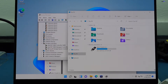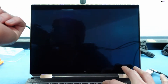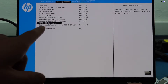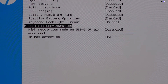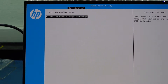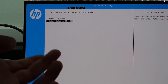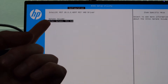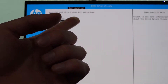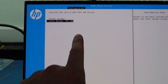So we're just going to go into the BIOS. Let's hit F10 — turn it on and just keep spamming it to make sure you get it. We want to go to Configure, then UEFI HII Config. We can see there's an Intel Rapid Storage Technology driver here and we have an Optane drive — looks like it's about one terabyte. It's going to show up as 953 GB, but you can see it's Intel RST and it tells you exactly what driver it is. The RST VMD driver is the same one we talked about in our Lenovo laptop repair video.